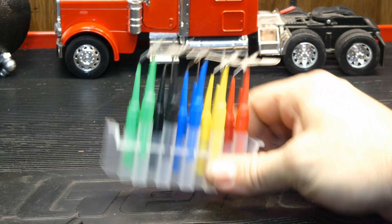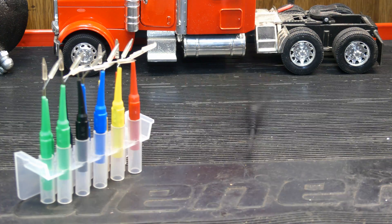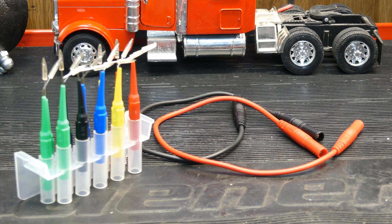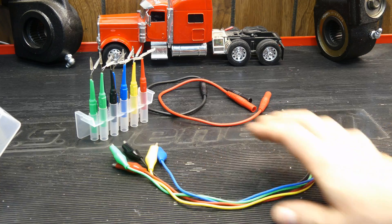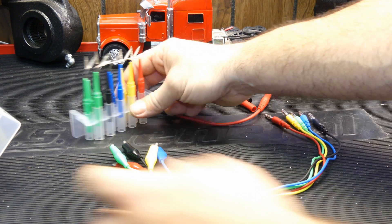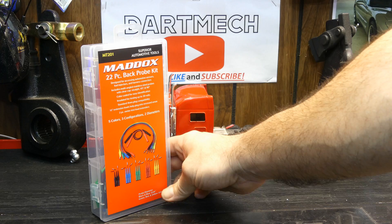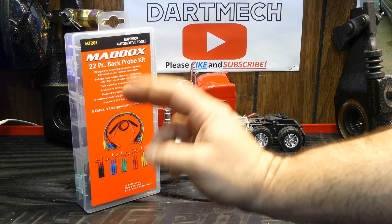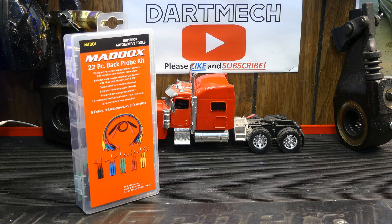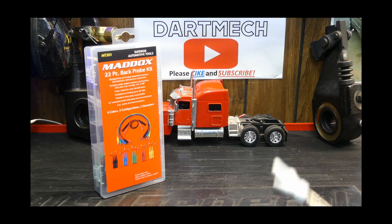Build-wise, this is a pretty good kit. The back probes, even though I'm hesitant about them, are made really well. It comes with two banana leads for your multimeter and then five leads with banana style plugs on one side and alligators on the other. So for $15, it's not a bad deal - you do get some pretty handy items. Will you use it every day? Probably not, but it's definitely good in certain situations. You don't need my permission to use a back probe kit, but if you're going to use back probes, make sure you do it properly, or else the technician later on down the road is going to have a different problem to figure out. I hope you enjoyed the video, and as always, thanks for watching.